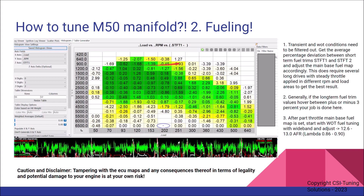Transient conditions are any high or fast RPM changes, changes in load, deceleration, or acceleration — these affect the base fuel map because the ECU has many other factors that come into play when decelerating or accelerating, multiplying values to the base fuel map. To get correct values, you need to filter those conditions out. When doing a long logging drive, keep the throttle as steady as possible across different areas of the map. Mainly you're concerned about the cruising area — low to mid RPM, mid to low load — and the higher-speed section during highway driving. Some areas like the upper right and lower left of the map are very difficult to get good data from, simply because it is difficult to get the car into those conditions.